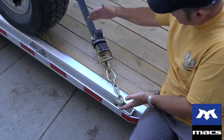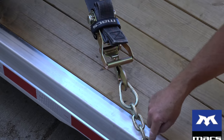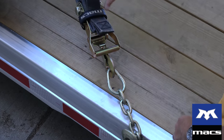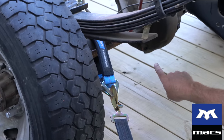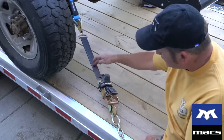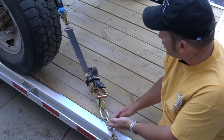On the left side of this vehicle I've got our direct hook ratchet connected to a chain extension. You can see the ratchet handle is out from underneath the truck as much as possible. I've got the chain extension drop down through and hooked over the top of the stake pocket, and everything's real happy going up to the axle housing with an axle strap around it. We also have about another six inches of take-up room possible before we need to make an adjustment on the chain extension.